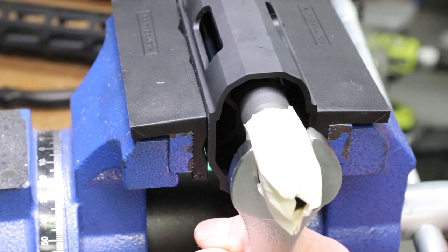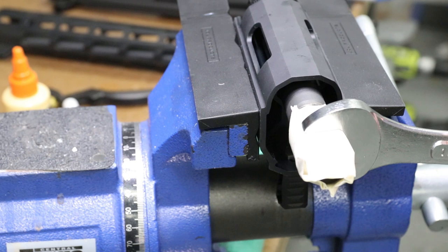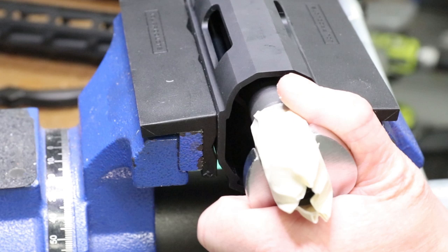You can also put a little grease in there - I definitely probably could have done myself a favor and added a little. So it's crushing away, back it off. Not quite there. So we've got about 90 degrees left of rotation before we're perfectly timed. We want to make sure we're backed off because we're not backing off anymore. We're going all the way from here - we're going to do our full 90 now.